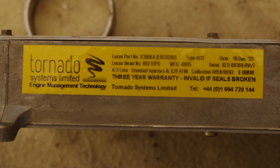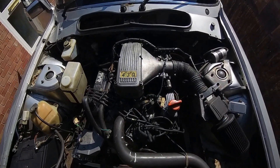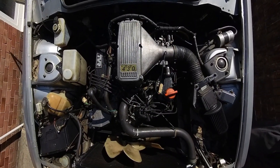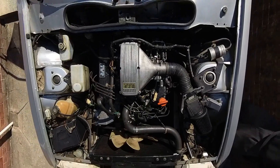With that came instructions on how to set it up on a rolling road. We've only got two things we can do really: we can swing the timing and we can mess with the fuel pressure. The characteristics of the ECU and engine are pretty well matched now, but we have to up the fuel pressure a little bit to get the fueling right where it should be. That was the purpose of today - to set the fueling up and swing the distributor timing to find best power.